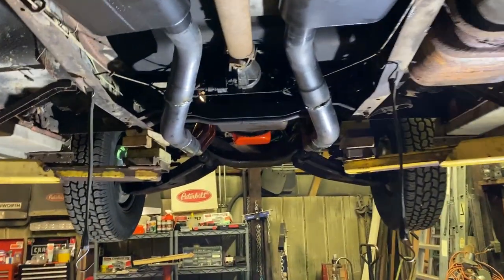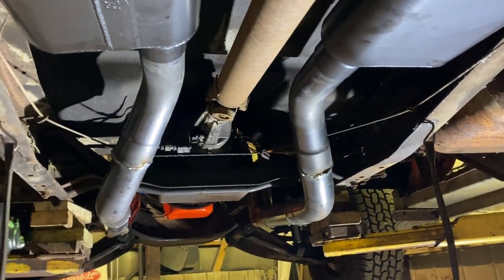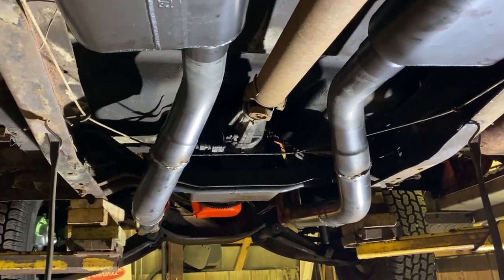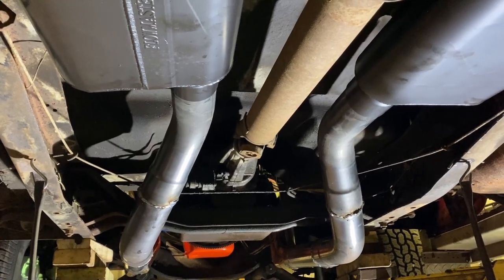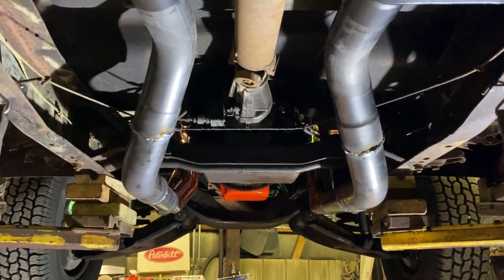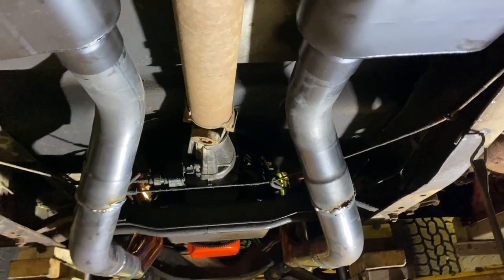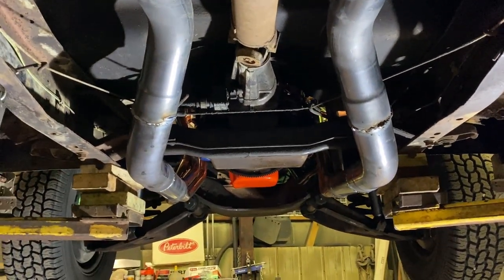All right, hey guys. I did some adjusting on the motor — I had my friend come out and take a look at them. The rocker arms were about a half a turn off of where they should be. It definitely quieted things down a lot, but there's still a couple that are kind of loud. I think I've got a couple bad lifters, but I'm going to dig into it some more and see if I can get them to shut up.